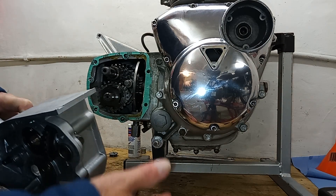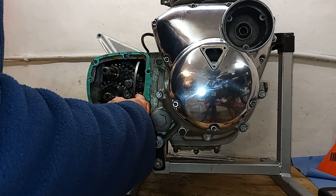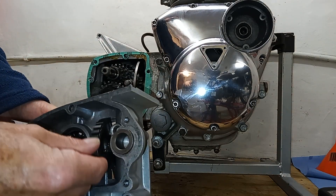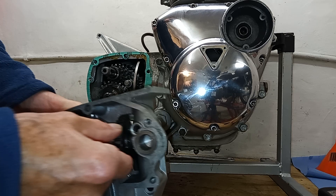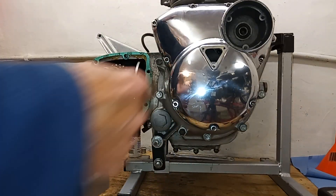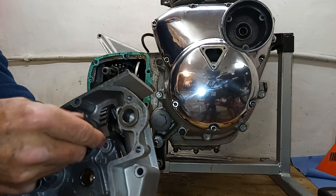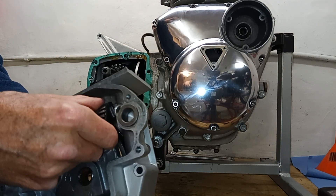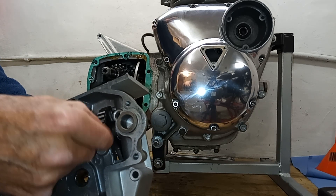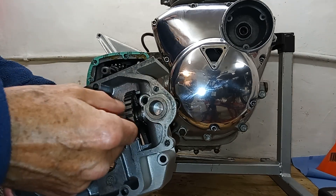So basically indexing the gears means making sure that's as low as possible for first gear, and this is as low as possible. The problem is when it's absolutely fully down, if I put that on, the teeth won't engage - they sort of clash with each other. So what you have to do is move it the smallest amount possible until the teeth engage, and that's it.